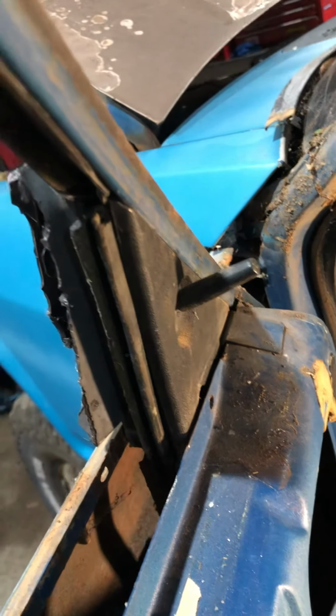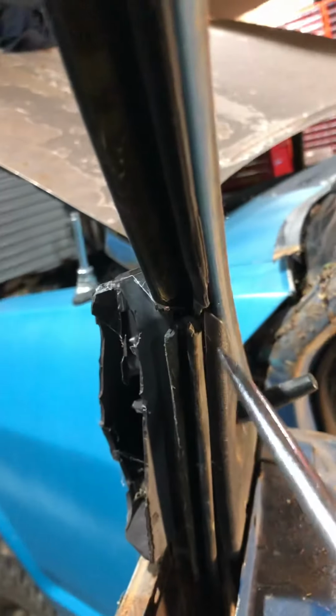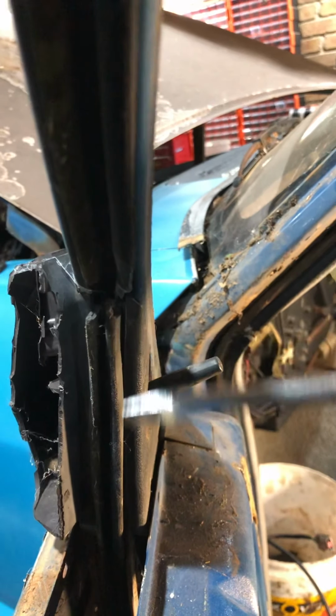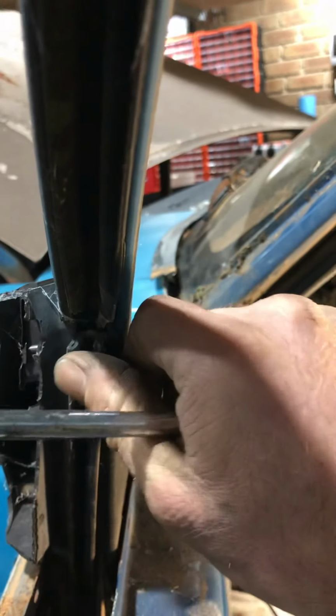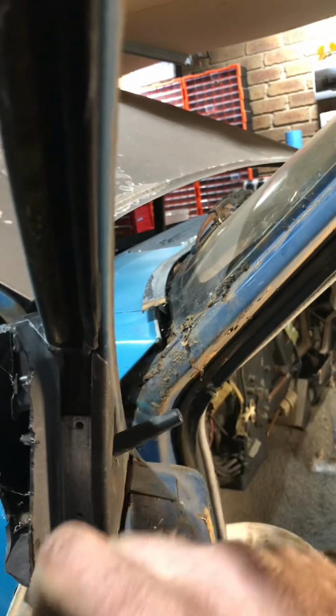What you can do is get a really small flat blade. Be very, very careful and wedge it in between, and then pry it so it comes out. That is what happens most of the time. It will break the Bailey channel in that corner. Whatever works for you, works for you.